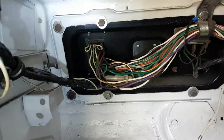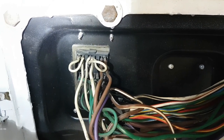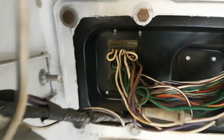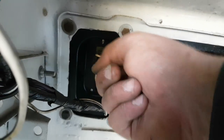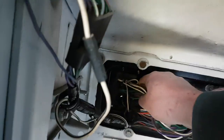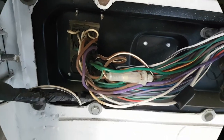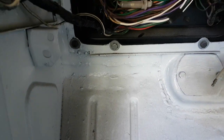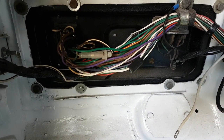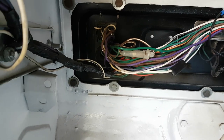One of the nice things about having a field full of old Range Rovers is that you can go and look at how the wiring works. Thank you, gravity. Look at how the wiring works on the other cars. Now, on the other cars, there's two wires that come off each of the fuse positions. So let me take that off for a second. There's one fuse position, only one wire. There's the other fuse position, two wires. So one wire has disappeared from the back of this fuse position, and it is the wire that goes back and bridges in. So it looks like it might have either been pulled out or was never there because it was part of his immobiliser circuit that he rigged up, which I've been desperately trying to undo.